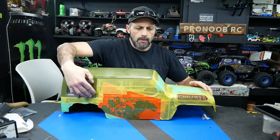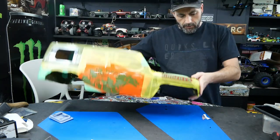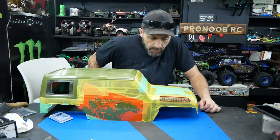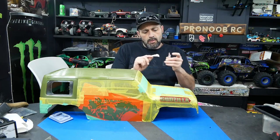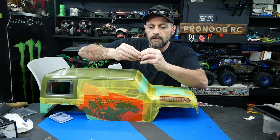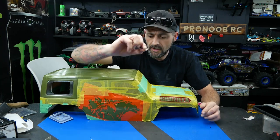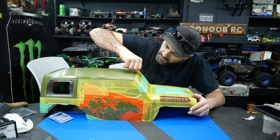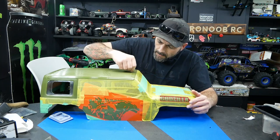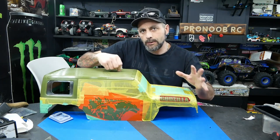So pretty much at this point now, we've gone over and sanded everything out with the, where did my sandpaper go? Right there. This is 600 grit. One thing you're gonna wanna make sure you do is fold this, push it up so it's kind of a little round area, and then you can get that little round guy to ride right in this little seam all the way down. So now anywhere that it's still shiny has to be made dull by sanding it, which will let you know that it's being scuffed up enough that the paint will grab and bite in there.